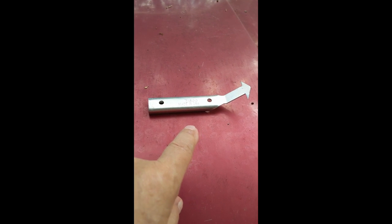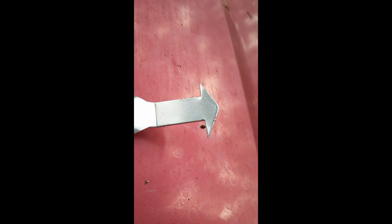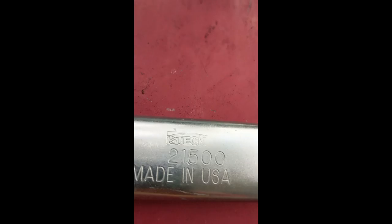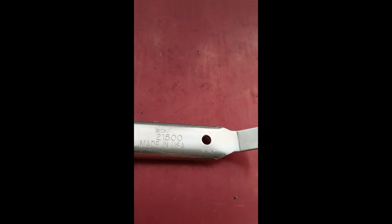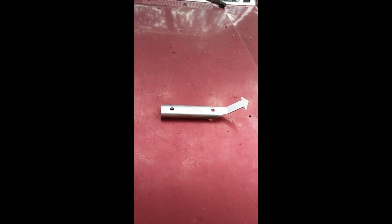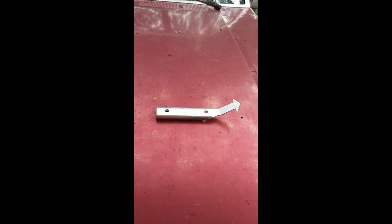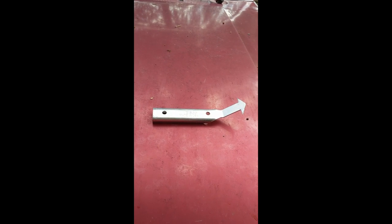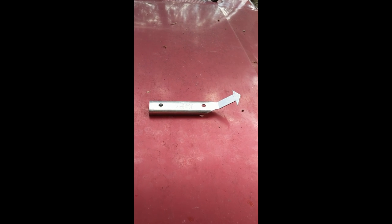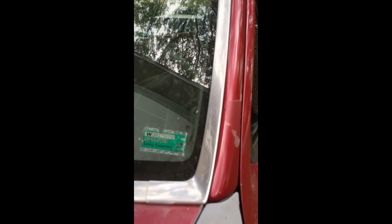This is the tool we selected — there are a few out there in different shapes. In my research, what I found was that this end needs to have a tip that comes to a very sharp point for it to work well. This one, made by Stack, fits that bill. One thing to note: the packaging shows clearly that this tool should be inserted from the glass side of the trim and not the paint side. Some Ford forums suggest using it from the paint side, but I believe that is incorrect.